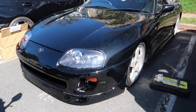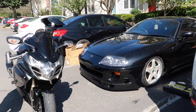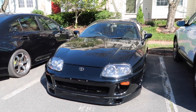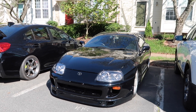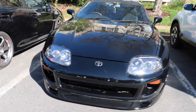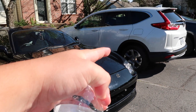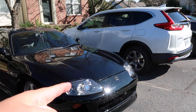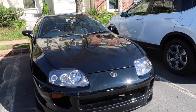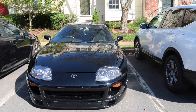This whole new look now. We've got to go give Jimmy his first ever ride in a right-hand drive. Here is the final product — if you have a Supra and you don't have the '97-'98 headlights on, I don't know what you're doing. These look so good with the black housing. It was super easy to install — really just three bolts, move the battery for access to the back of the headlamps, and move the intake box. All the bulbs from the '93 to '96 headlights just swap right over and you're good to go. It gives the front end a completely different look — I'm in love.